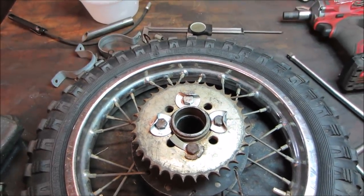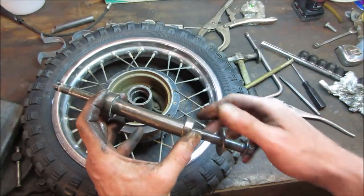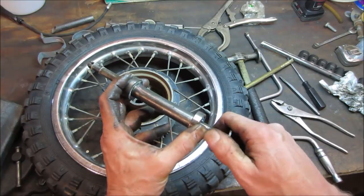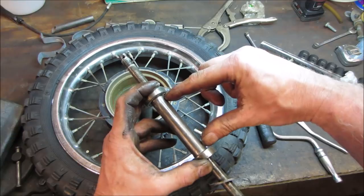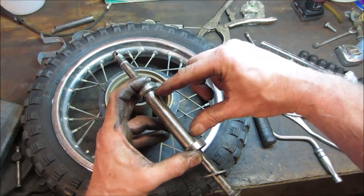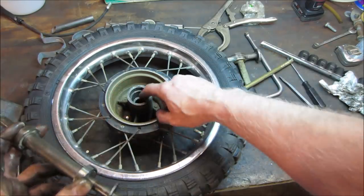Onward and hopefully upward. So that's what's inside the wheel, although the axle doesn't spin. It gives you an idea of what will be in there. So that is supported in the hub, and this is the section that's turning. Everything else is staying still. But that gap has to be pretty close, because if I left it alone, over time, from the wheel pushing back and forth and the aluminum stopping in a little bit further, it'll start pounding itself to death, and then the outer race of the bearing will be loose in this surface.